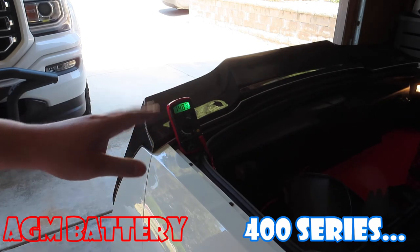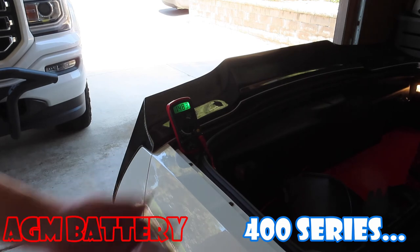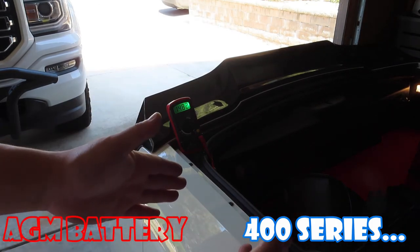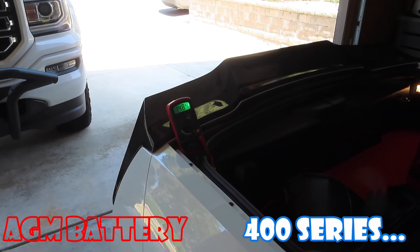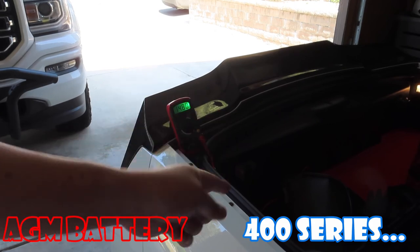I'll leave it to see where the voltage goes — I think it's good. The car starts. I'm going to follow up the next day to see how the new battery performs and put the maintainer on to make sure it works fine. If it all works, this battery is good. I'm also going to let it sit for six hours to see if the battery maintains its voltage.